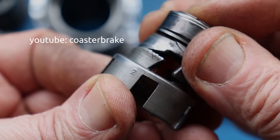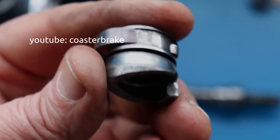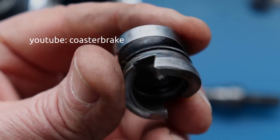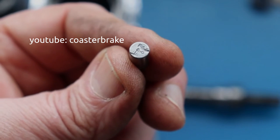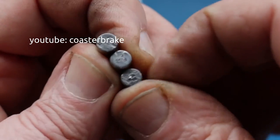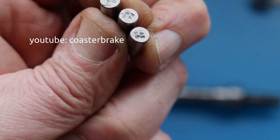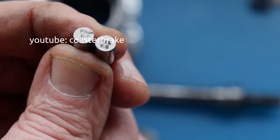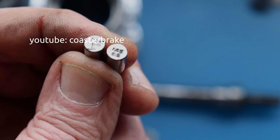The people did not have so many parts and the bike was so much needed. This brake cone does not have a year stamped on it and it is broken — better not to use it any longer. And this is very special: normally the five rolls in a Torpedo are stamped 6.5, but the person who repaired this hub used both 6.5 and 6.6. This is not good — only use 6.5.